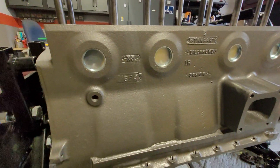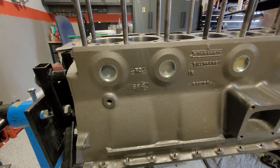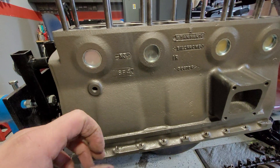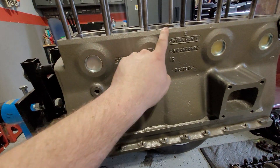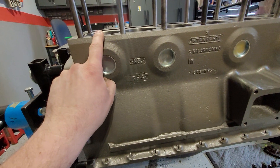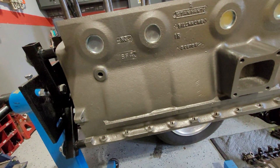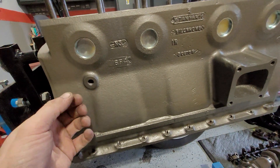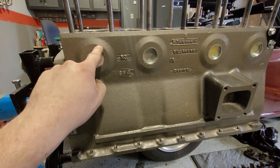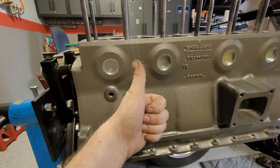I hope that's useful for you when you go to measure the gap and make sure it's within range, unless you need to get it machined. Any good questions, let me know. The information is in the book — if you go to the pages of the actual pistons, it will tell you A and B, and the measurements or the range in which you have to be in. No different than the range for the big ends or the bearings — you've only got so much play before you have to go to an oversize. These are the exact same, so you measure your top, middle, and bottom. That's where you know which piston was in which one to do your readings. Thanks for watching, hope it was useful.